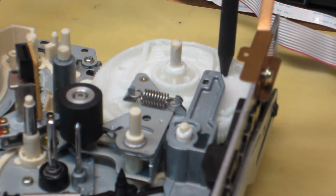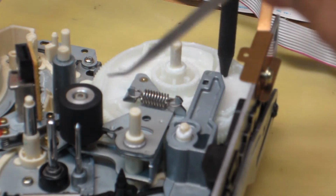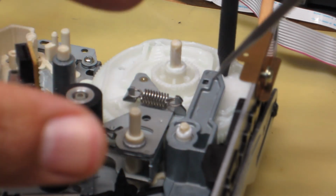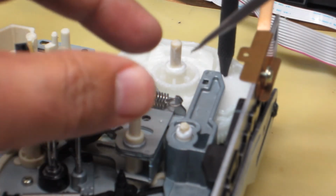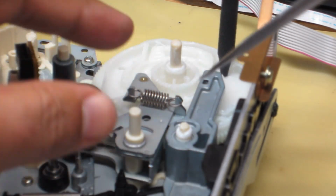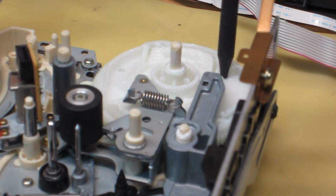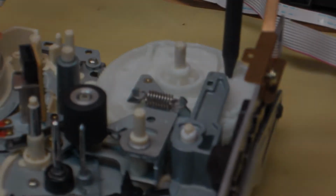Okay, so the remainder of that loading drive assembly, that housing there, is going to snap back over the cam gear. As you can see, I have that punch drop down through that alignment hole, and so everything's in alignment here. When I set the remainder of that loading drive assembly housing in place, everything's just going to line up perfect, okay? And that's how it has to be for the whole mechanism to function properly.